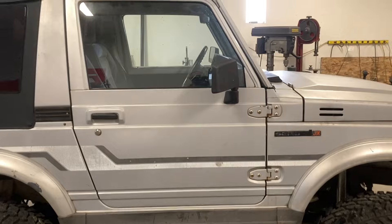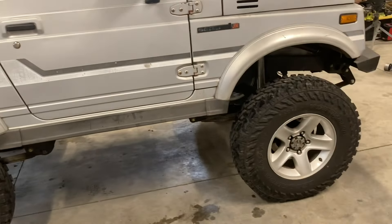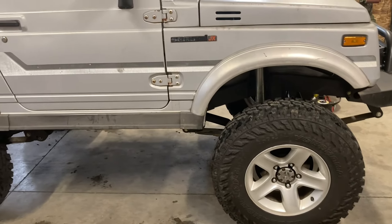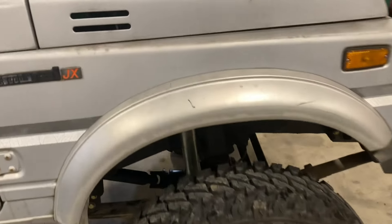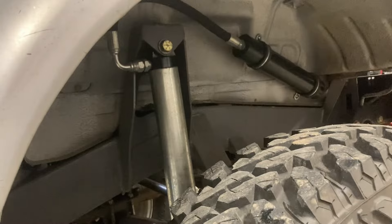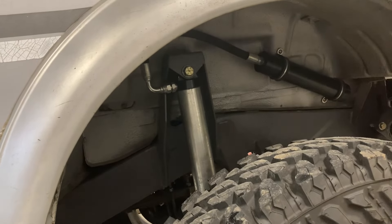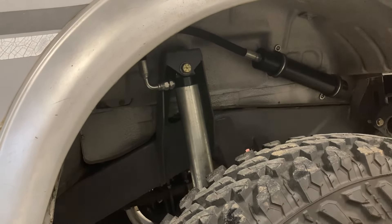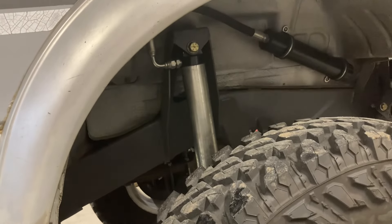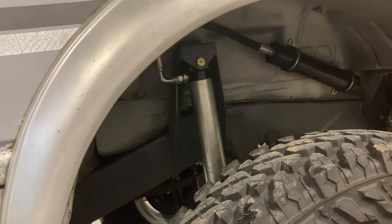Pretty happy with this thing. Can't wait to see what he thinks — he was happy with the ride before, so I think he's going to be real surprised. Those bushings did kill all of the little noises. This thing is actually pretty rattle-free. Even the front ride — changing nothing but putting those bushings in — it did soften the edges of bumps a little bit, being that it's got a little bit of give. Something not a lot of people know is OEM manufacturers spend a lot of time on the bushings. A lot of the ride control of high-frequency bumps is controlled by the bushings. I know Bilstein does — their bushings are built vehicle-specific. There's a lot to be had in the little details.